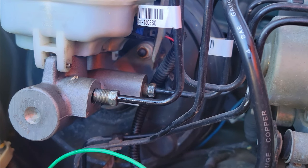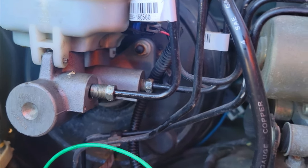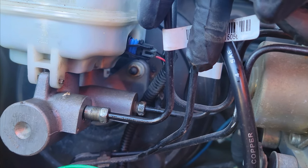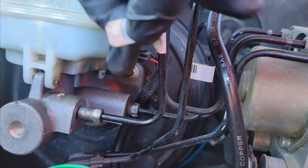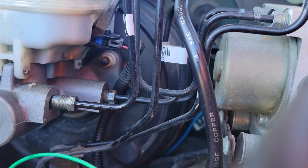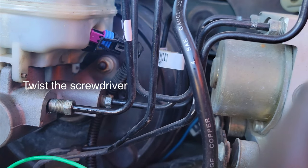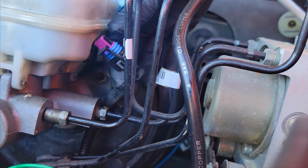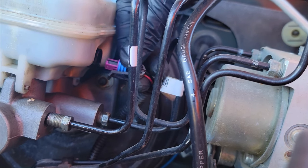The next thing I'm going to show you is that you can't get the wrench in here to turn because this plug interferes with the path of the wrench. The way to get it out is I took a little screwdriver and stuck it in this little tab right here, just spaced it out a little bit, kind of pried it open, and then pulled on it. Mine came out really easy. You can use WD-40 if you can't get your plug out.